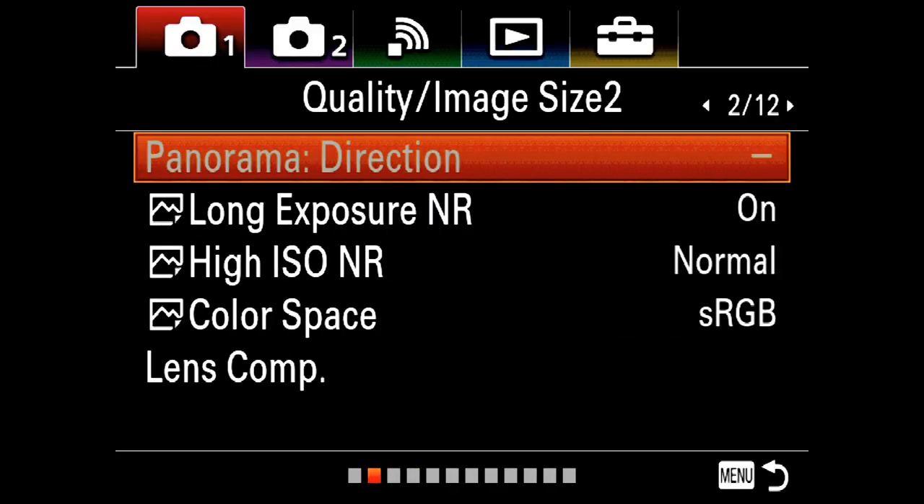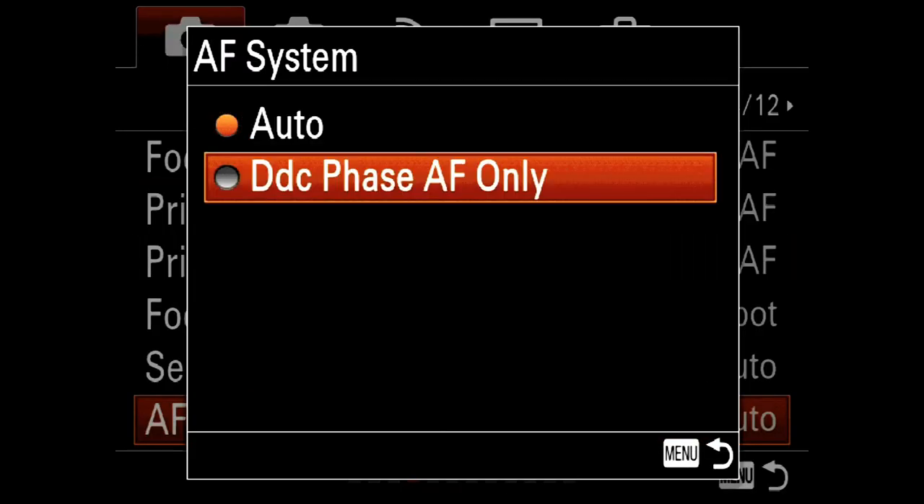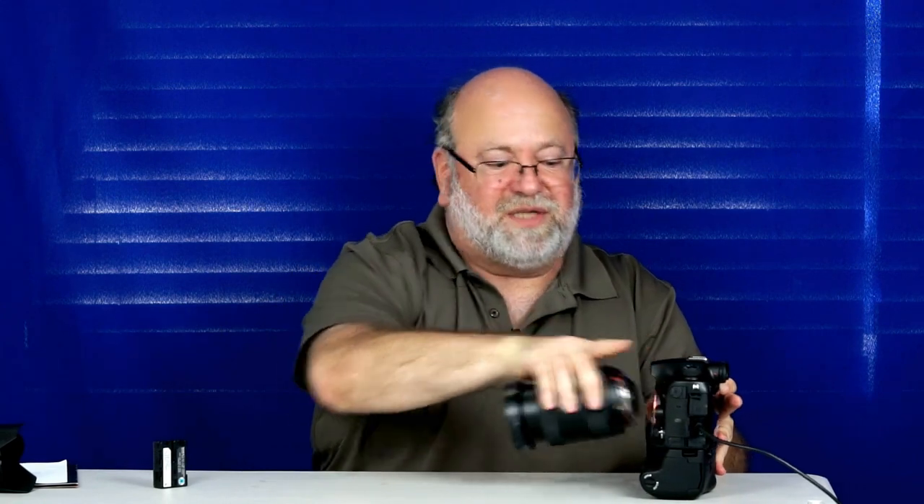It's actually not quite true. Let me change another setting. Menu, page four, AF system — let's switch that to dedicated phase autofocus only. Some of you may remember this camera has two kinds of autofocusing systems. The first is the kind used in the Sony Alpha 7R II, where autofocus points are built right into the sensor. For technical reasons, those can only detect vertical contrast. In addition, there is a dedicated sensor behind the semi-transparent mirror — that's the only reason that mirror is there.